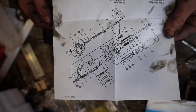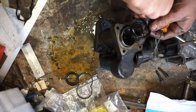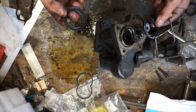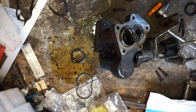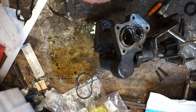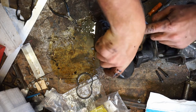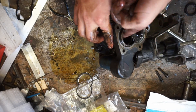Parts 32 and 17 are what we're going to be replacing here. Notice how it came out — the lip was facing up and out, so that's how we're going to put it back. Let me get some towels, then just oil up your new seal and stick it back in the hole.